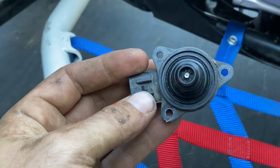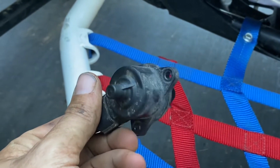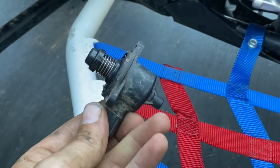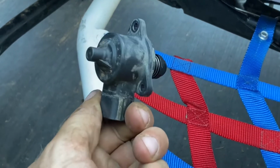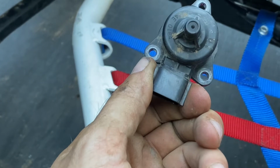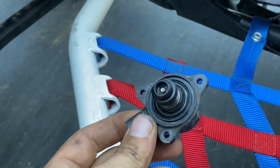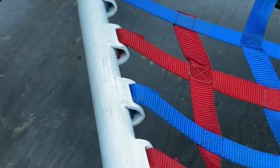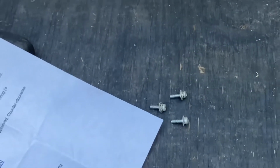If you were to ask me how to adjust this thing, not having any knowledge of the Yamahas, I would tell you you're not really able to at all, because this is a pretty fixed unit, and this is where all of your air adjusting would be, including the O-ring that just fell out. You will need none of it. The only thing you will need from all of this is those 3 screws that you just took out.